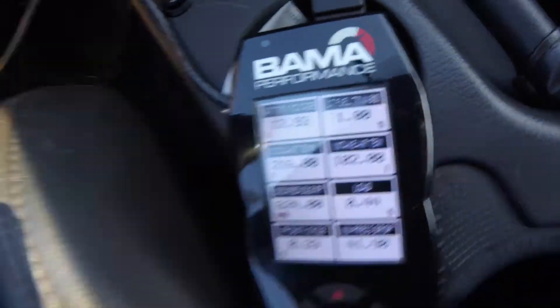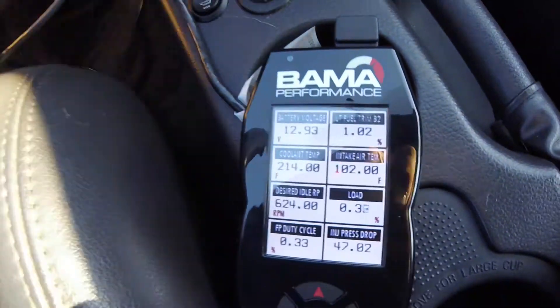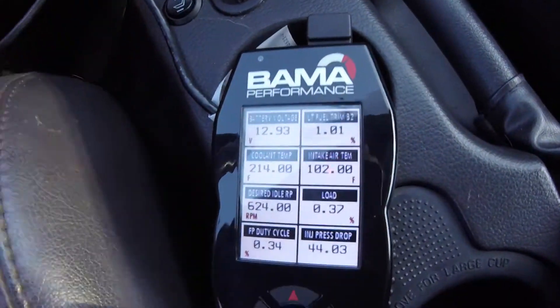So I got the intake on, I've been driving around for about 15 minutes, my engine is warm, and right now my intake air temp is 102 degrees. It's actually a couple degrees cooler out — about 82 degrees compared to 84 or 86 before — so I don't think the heat wrap is doing anything. My average intake temperature is about 102 at 55 miles an hour.